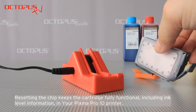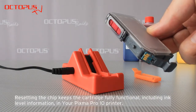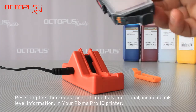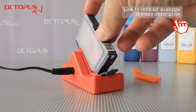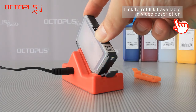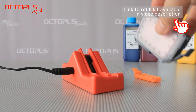Please reset the chip on the cartridge while the cartridge is empty. The cartridge only fits into the resetter when the ink outlet is not covered by the orange cap. Set the cartridge into the resetter and press it toward the contacts. The cartridge LED blinks shortly when contact is made and shines during the reset process. When the LED turns off, the cartridge is reset.